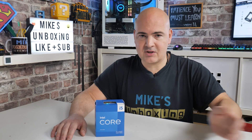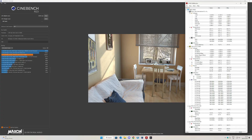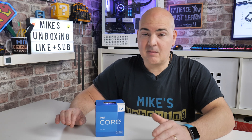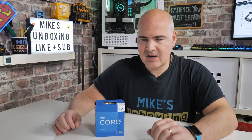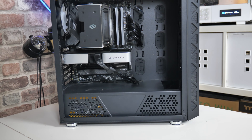So I gave up on the contact frame and went back to my original setup, which from slide one was the best performing thermally. I put the original fittings back on, put the CPU back in, fresh application of MX4 compound, same cooler, same everything, ran the test again - and as you can see, we're basically exactly the same as our original baseline. I have no idea what is going on. I've not done anything in the BIOS, not changed fan profiles - the BIOS is set to standard. We appear to be using more wattage and getting hotter for basically the same result, between going to bed and waking up the next day.